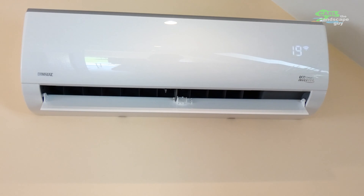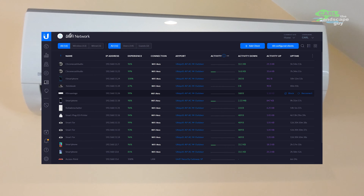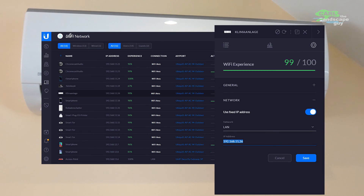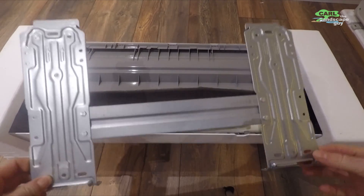All in all, I find the Wi-Fi integration very handy. The connection runs reliably if you assign a fixed IP address to the air conditioner. If you're using the Unifi network like me, you can find the device under 'Clients', then under 'Configuration and Network' you can activate the fixed IP address and enter a desired IP. According to the manufacturer, a fixed IP improves communication because you probably use the connection seldomly and it doesn't have to be established permanently.